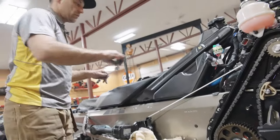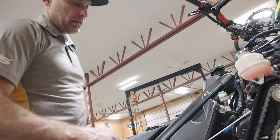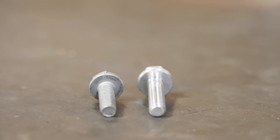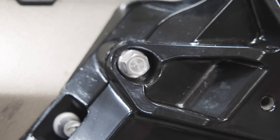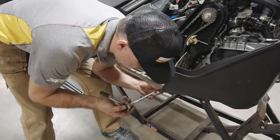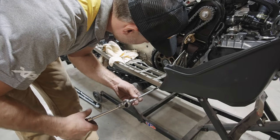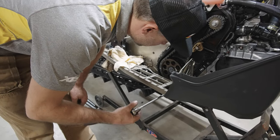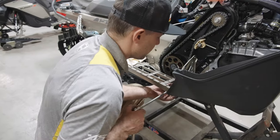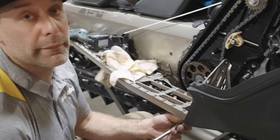We're retapping because we're going to a treated aluminum fastener, so it's definitely very aggressive as far as weight savings go. These threads are made with what I'd call a stover-style bolt, which is a triangulated thread — usually called a stover nut, which is basically a lock nut but triangulated. The reason they use this stover-style bolt is it's efficient on the assembly line — it's the fastest and it's adequate, but it's just a steel bolt.